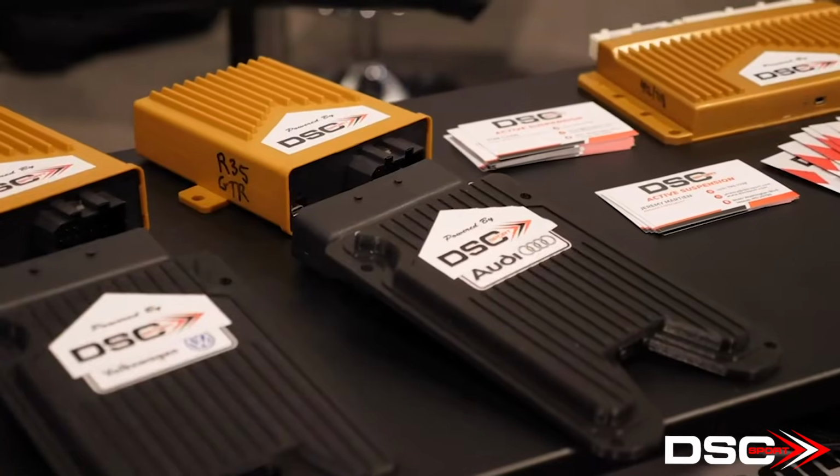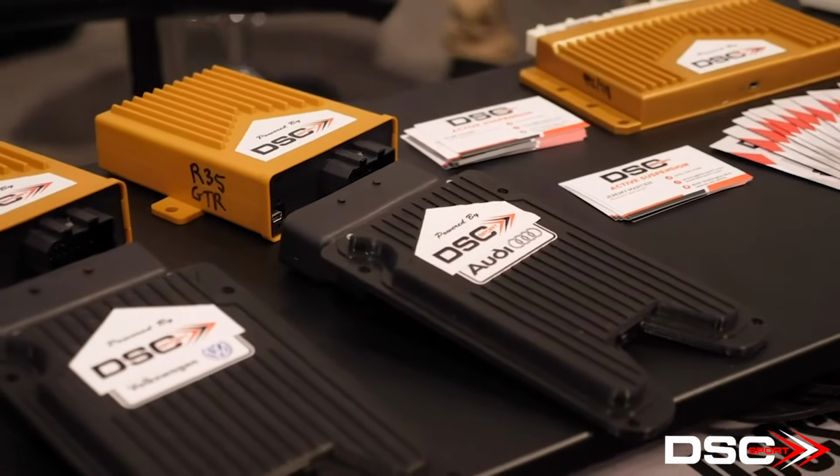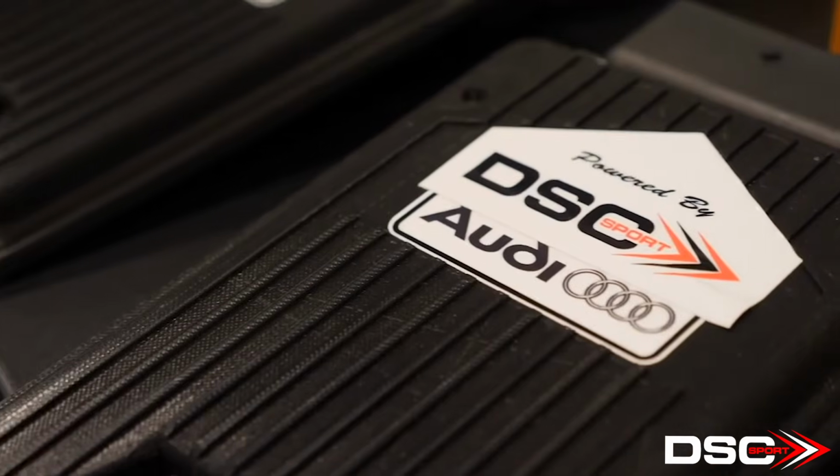All of these dampers are amperage based. It's current based. We can control the peak stiffness of the electronic bump stop. You can change the ramp angle of it. Awesome product, really innovative, and it almost harks back to some of the F1 active suspension technology starting to trickle down into road cars and enthusiast track day cars.